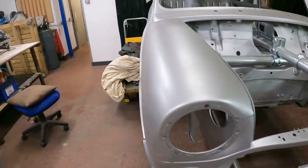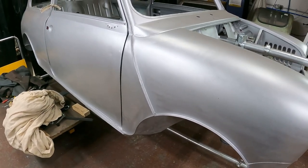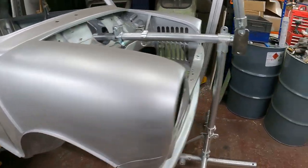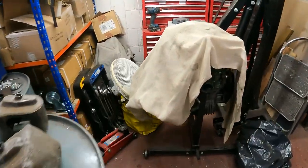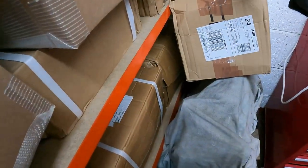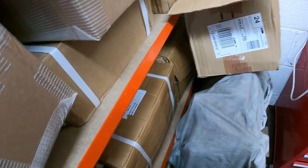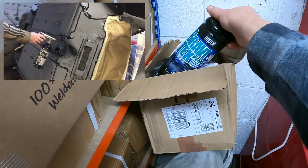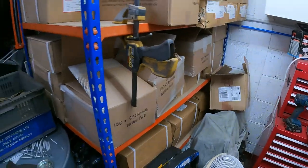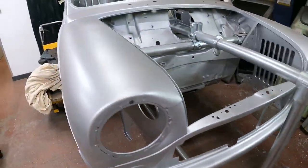I'm not too sure of the sequence of events for painting it. I'm going to do the underneath first while it's on the rotisserie. So epoxy, and then I've got some, what have I got? Some big spanners. Got some, oh, it's Gravitex. That's the stuff you can paint over. I think the other one you can't paint, you have to tint it. But that one you can paint over. Correct me if I'm wrong, but...